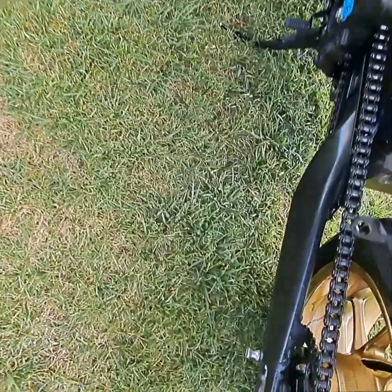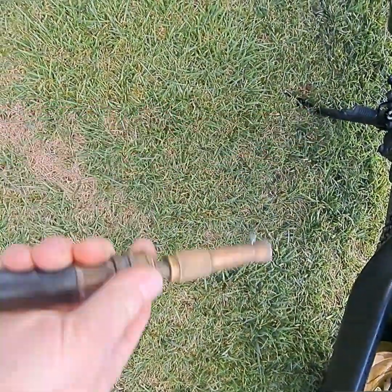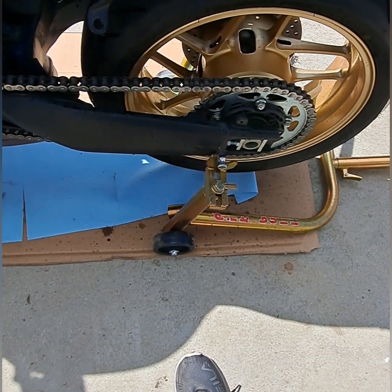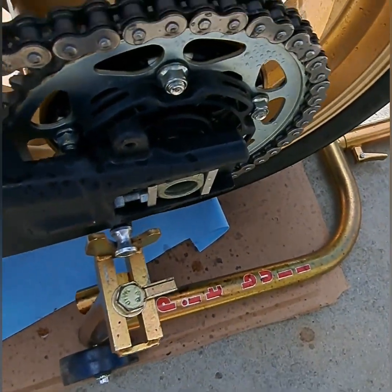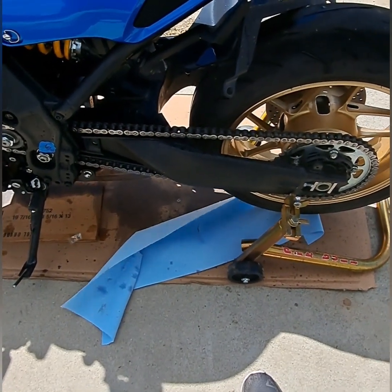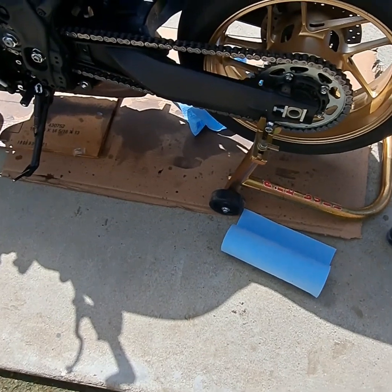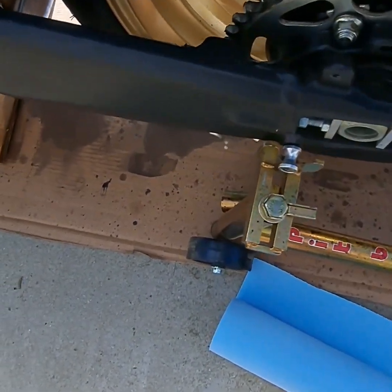Once you get your chain clean — you can see that stuff really got that chain clean, it's looking more silver now — then just get a regular garden hose and hose that chain area all down where that sprocket is. I cleaned up that cardboard and put some fresh paper towel down. I took the bike off the front line after I washed it with the hose and put it back on the stand. You can see that chain is really clean, kind of a silver color. Now I'm going to get an air compressor and spray off this chain and get all the moisture out of it — I don't want any rust forming. I got some paper towel, rotated the tire, and really cleaned that chain as a last step.